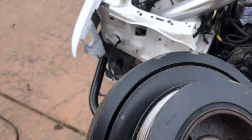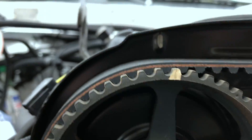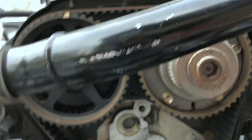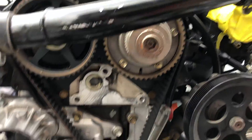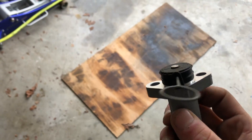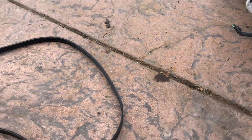This is now garbage. We got that timing mark, this timing mark, and that timing mark — all good. This big nipple here, I'm not sure if I could sneak that through, so I actually do have to untime the motor. But we're at top dead center, so it shouldn't be a big issue. Really very gently decompressed the piston in there, and now it's decompressed. Kind of nerve-wracking, but I think it's safe.